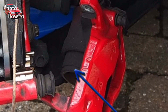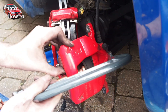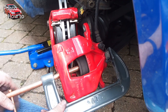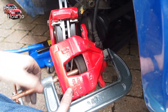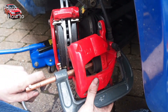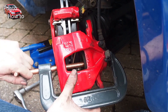You may have noticed how far out the piston is sticking — we need to push that back in, and the fact that it's sticking out so far just gives you some indication of how badly worn the brakes were. I use a large G-clamp, hooking it over the caliper, placing the end onto the middle of the piston, and gently winding the piston back in until it's all the way back. When you do this, take the lid off the reservoir for the brake fluid so the fluid can move back up into the reservoir without pressure building up — it's not a pressurised system and you don't want to burst the reservoir and end up with a brake fluid leak inside the engine bay.